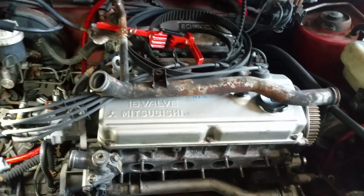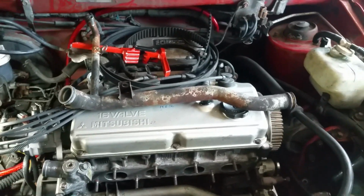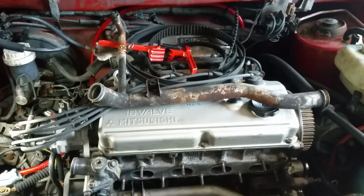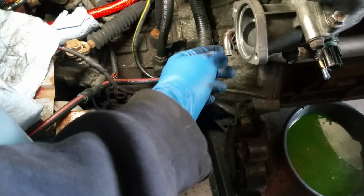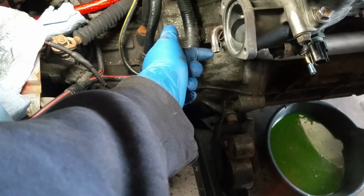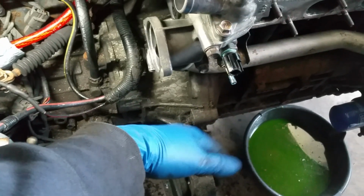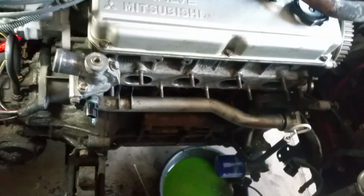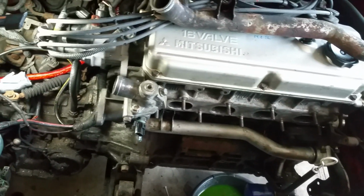And again, the whole reason why I'm making all this work for myself, I did not need to do this. This was not part of my maintenance checklist. The whole reason I was doing this is because I don't want to open the cooling system again when I go to install the turbocharger. I just want to have a hose that loops from here to here when I don't have the turbo on. When I put the turbo on, I'll pop the hose out, and I'll have a substantially smaller opening for flow. I can quickly plug that while I do the turbo stuff, then take the plug off, put the hose on, and route it to the turbo really quickly. That way I don't lose as much coolant and I don't make a huge mess on the ground. I don't know why I just hate opening the cooling systems, but it's just annoying.